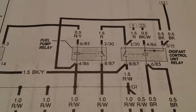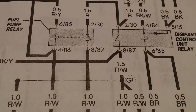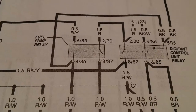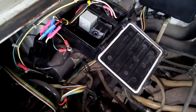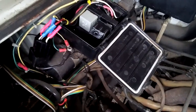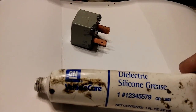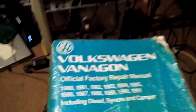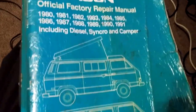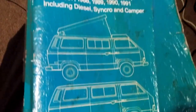This is the 1988 factory service manual circuit diagram. As you can see, it shows the same kind of relay as the cheap ones, and it doesn't appear to be necessary to have the diode working — just to have the signals in the right place on the right tabs. Verified by the cheap relay in place and the engine running. I use JB Weld to put the original relay cover back on, and afterwards it's best to lubricate it with dielectric silicone grease to prevent future corrosion. I really appreciate Musty One's videos, as I've learned a lot from them. The Bentley service manuals have been invaluable to me on my own Vanagon adventures. Hope this helps some folks.